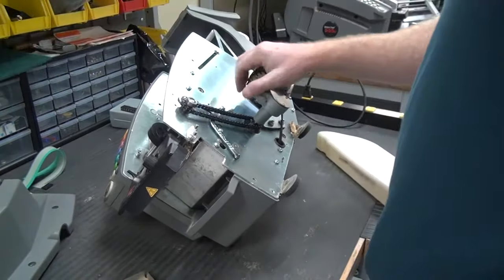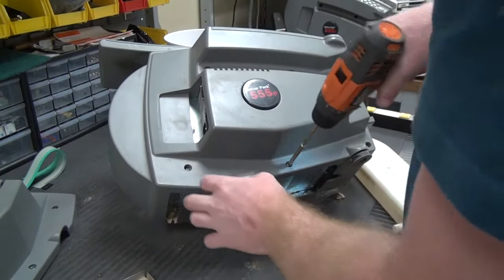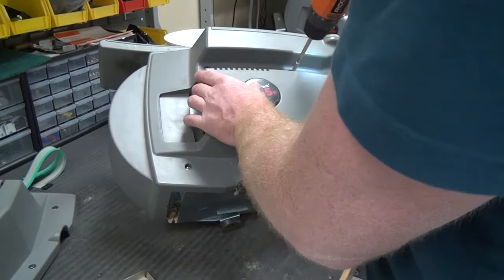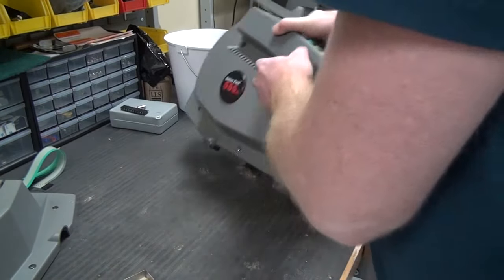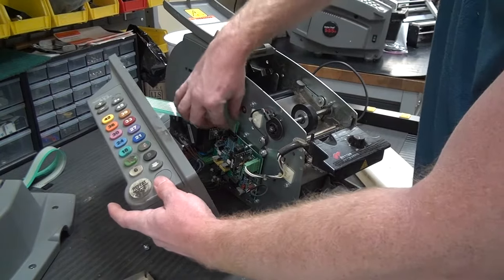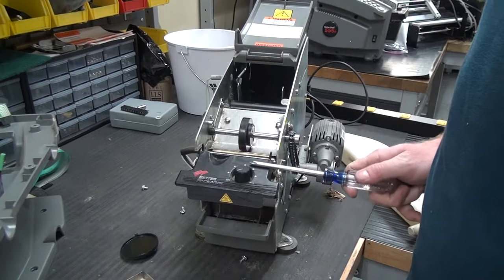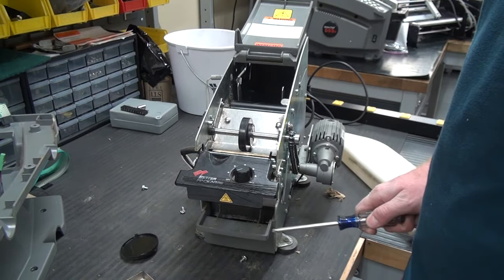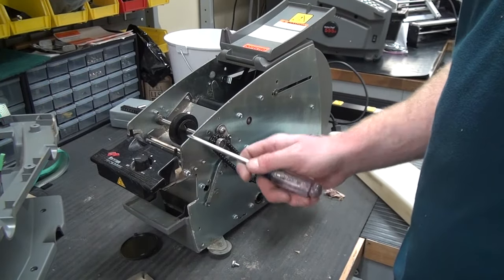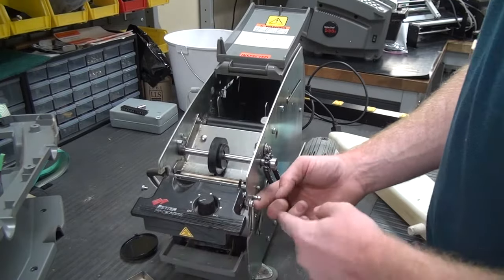This is ready to come off. I like to look at the chain and make sure that's in good order. Go ahead and unplug the machine and take this side off. When you take this cover off, be mindful — you've got your ribbon right here for your keypad, which is still going to be attached to the circuit board. Unplug that. Next thing we want to do is remove this heater, this plate here, and this lower plastic plate. It comes off pretty easy — just unscrew about a full turn; you don't have to take the screw all the way out. Take this bracket on the side and flip it around like that — it'll now be hanging down.